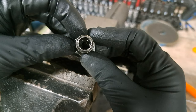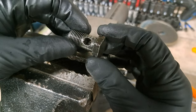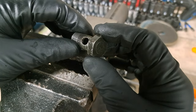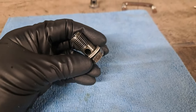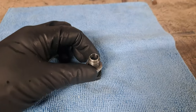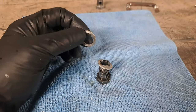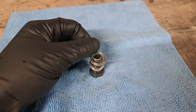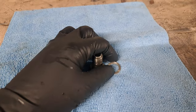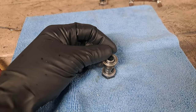Now that the restrictor is removed, the power steering pump and system will work in harmony without battling anything. A quick note: it is okay to reuse your crush washers. I sometimes just flip them and put them back on. If you have new ones, use them — but I've been able to crush these up to three times and they still seal up fine.